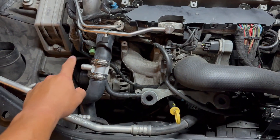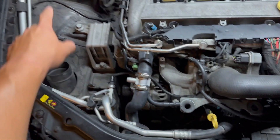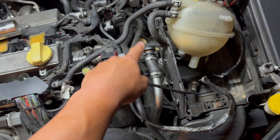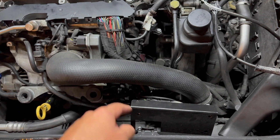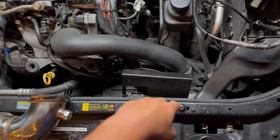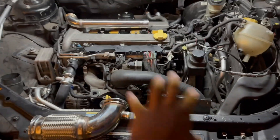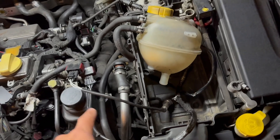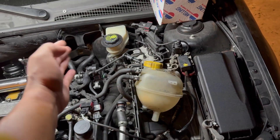This broke off when I was pulling this coolant pipe off — very common issue for this T to break. I've already pulled out the air box, secondary air pipe, and secondary air valve. I'm going to pull that secondary air pump down here. I do have the Taiwanese ECU relocation kit — there's no ECU in it currently because they always break, and I had to take this one and put it in my convertible that I just sold. I've got my O2 sensors here, EGT here, battery out, cooling bottle moved over.